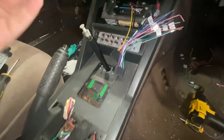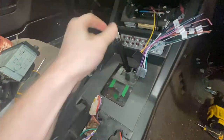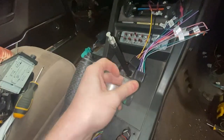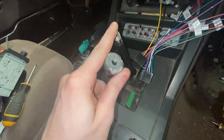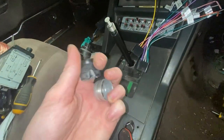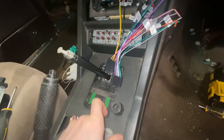The gear shifter comes apart quite easily as well. There is a little plastic lockout switch — mine's actually broken, it doesn't work, I can shift it with or without. But to get that off you take the little chrome cap off; that screw runs through the middle, so you can just remove the screw and the whole unit comes off. Then the only thing you have to do after that is unwind the actual gear knob itself, which obviously I've already done here.